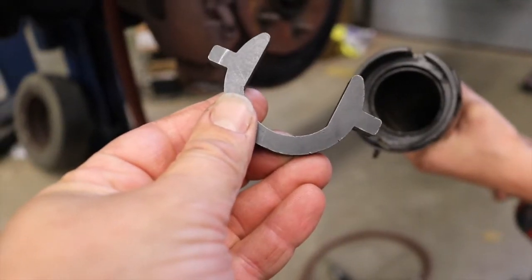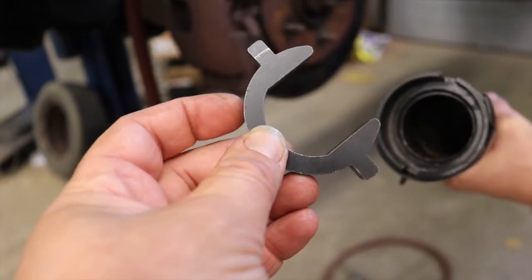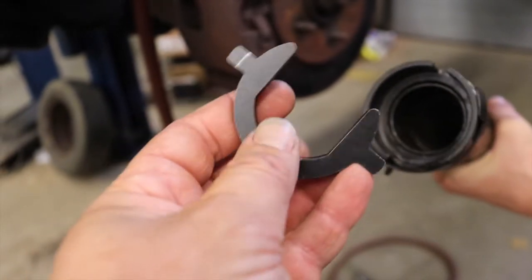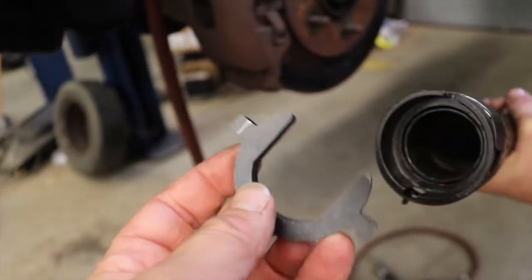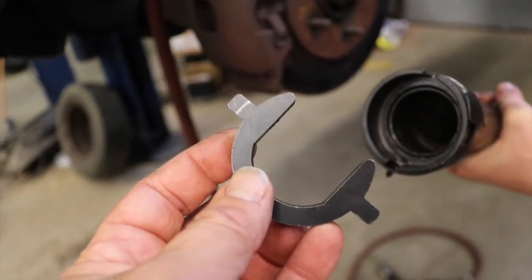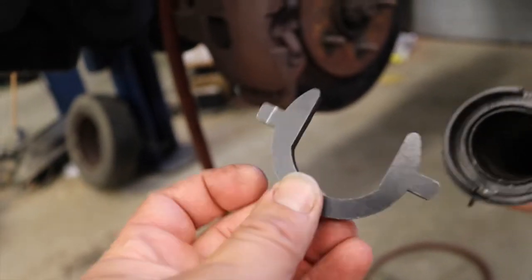The next step on the Dodge Caravan is to put the inner tie rods in, and this is the tool. Several months ago, I did a quick demonstration on this. So what's going to happen is this is the wrench that's going to go into this adapter that goes on the flats of the tie rod, and it gets locked into that tool, and then they're going to use an impact gun to tighten them down. So let's see if they can get that done.